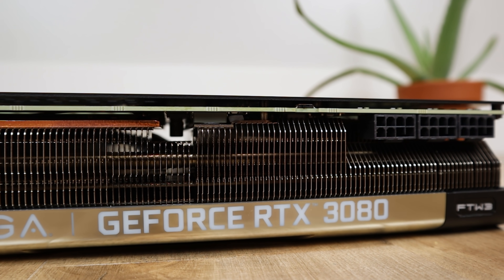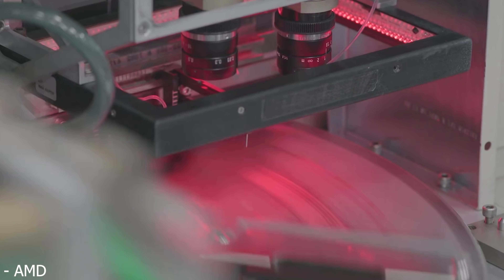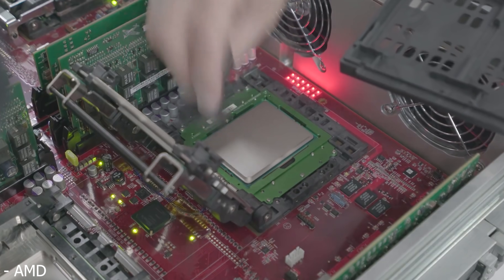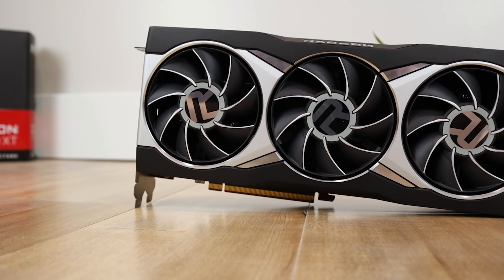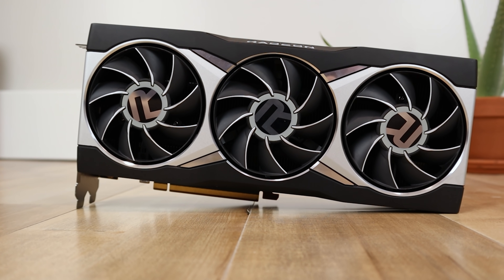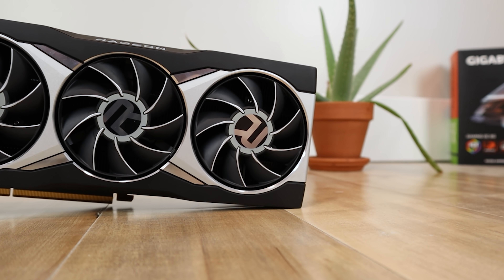That is going to lead to a situation where even if they produce a bunch of RTX 3090 dies, only a certain amount of them are actually going to make the cut. However, if you decide to do a chiplet design, you can cut a whole bunch of different GPUs out of it and connect them together like Legos. There won't be quite as many giant GPUs, and if there are smaller GPUs that are defective, it's a lot more cost effective to put together the ones that did work into one big GPU. You could have a 7900 XT, a 7800 XT, and maybe a 7700 XT with exactly half the amount of stream processors, assuming they all work.